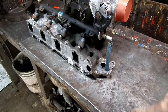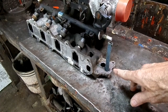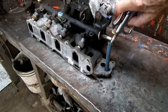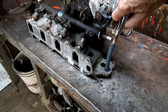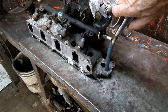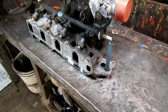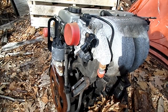While you've got your intake manifold on the bench, what you can do is blow some compressed air in this port right here and make sure she is nice and clear. You can hear and feel the air coming out of that one — she is pretty clear on this one. And that's my look at solving the insufficient EGR flow problem on the Saturn S-Series.